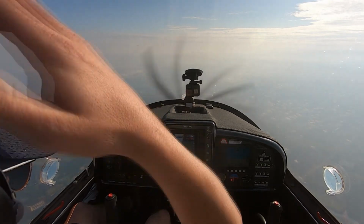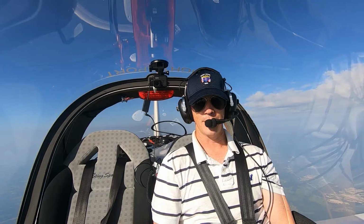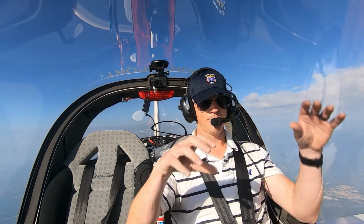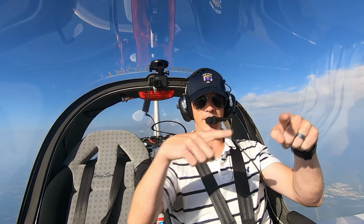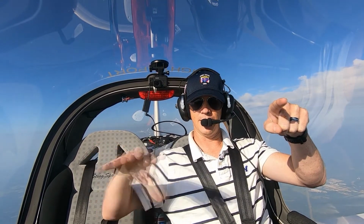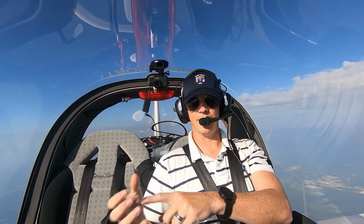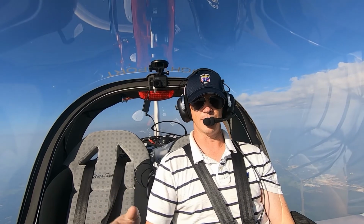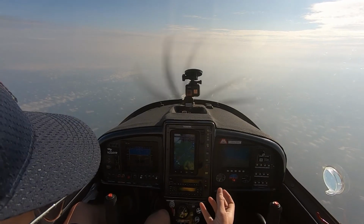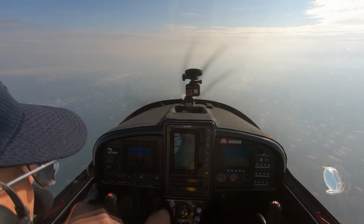The last time that I was up there, we talked about it, and what they actually think it is, is the fuel pressure sensor. So there's a 3-way split in the fuel lines, and then the fuel pressure sensor is down below that. And so the fuel that's sitting against the contacts in the sensor is the same fuel that's always sitting against the contacts in the fuel sensor. And they think that's why it might be going bad sooner.